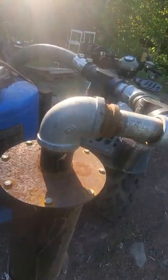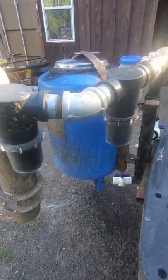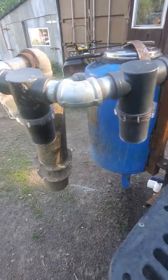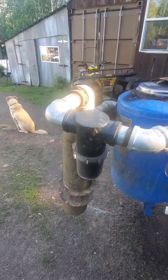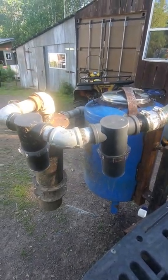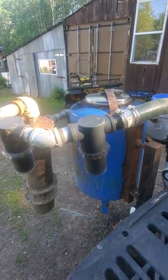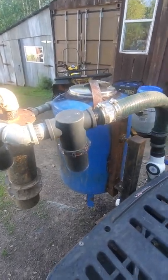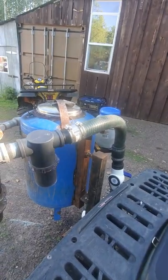And then the outgoing gas is up here. I'm just trying out these filters — I don't know if I'm too happy with them. I think they'd probably work for a smaller engine. For this engine, I probably should put them in parallel rather than series, and I think I'd get better filtration, but I still want a different final filter, maybe with a wall. So I'm experimenting with that, to reduce the amount of charcoal dust that actually ends up in the engine.